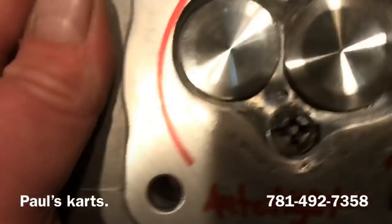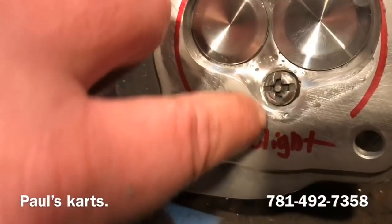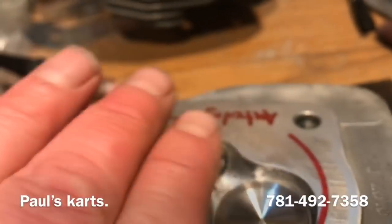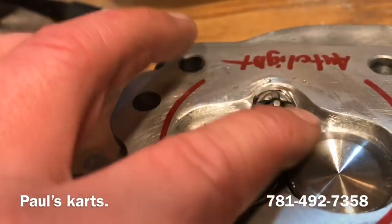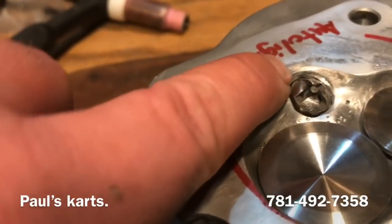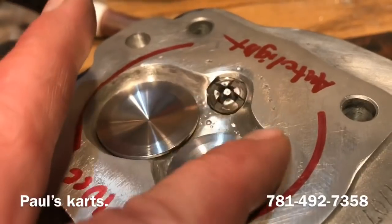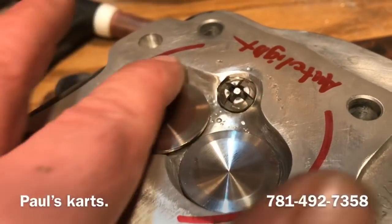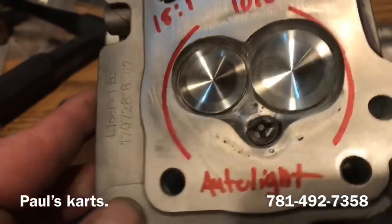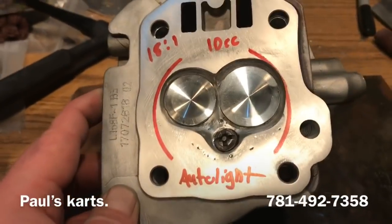If you notice, I relieved in and behind down in the spark plug area. The spark plug sits in at an angle, so it tapers up and around. The highest point is back here where the highest point of the spark plug is, and over here it slopes around to allow for any type of creation of movement. I have absolutely very limited space at this point, trying to maintain this compression ratio.